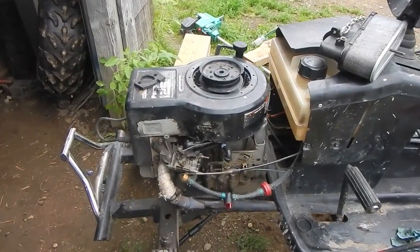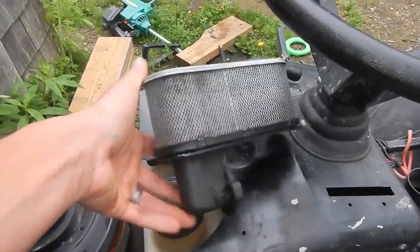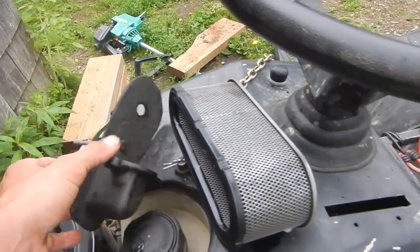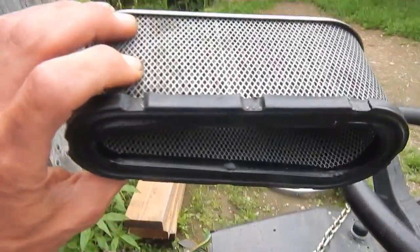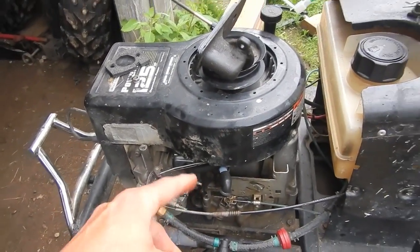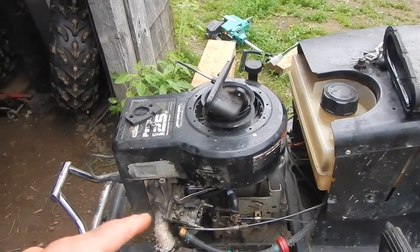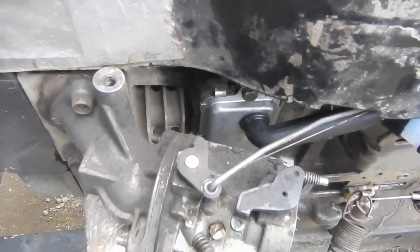Here's where we're starting — a very torn-down intake system on the Murray off-road mower. The air box is completely gone. This is an original air filter that's been slightly modified — it's like an open element, but these stock Briggs filters really don't flow well. They're paper filters, and the inside of this one is coated in oil. I think a lot of the problem is the PCV was allowing so much oil to pass through because the air filter was slightly plugged, which probably caused a lot of suction through that PCV system. I went ahead and bought a new PCV breather and installed it, even though the old one was probably totally fine.